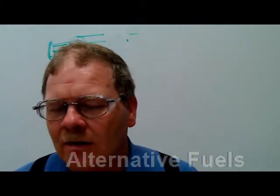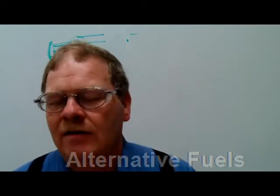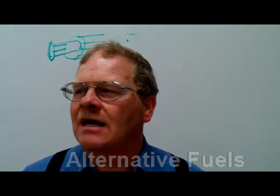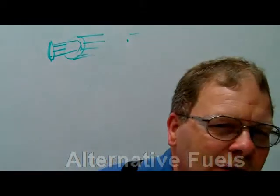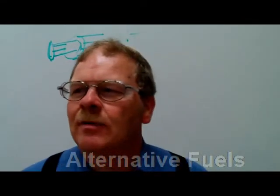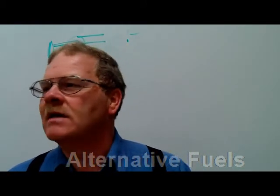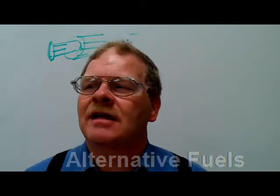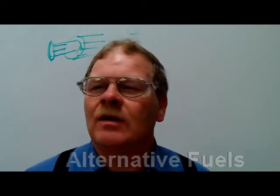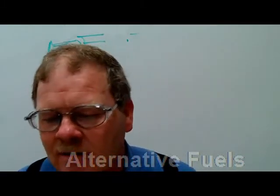But the point, here's the deal. E85 means the fuel is made from what? 85% ethanol. 85-15, that's right, 85 ethanol. Now, what I backed up and started to say was, you know how on the pumps it says contains up to 10% ethanol? If you take some of that gas, now that you know how to check it, you'd be surprised how many times you'll check that gas and it won't have any alcohol in it at all. It doesn't mean that it always does. It means it can have up to that much, or just notifying you. But a lot of times it ain't got no ethanol. So you don't have any way of knowing that unless you know how to chemically test it. You understand my point? All right. Now that's just something I wanted to say.